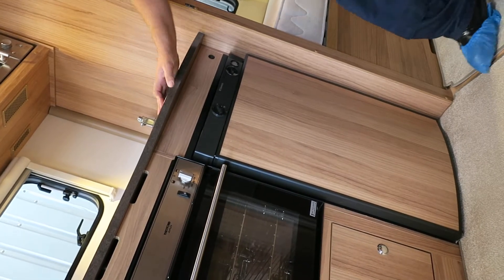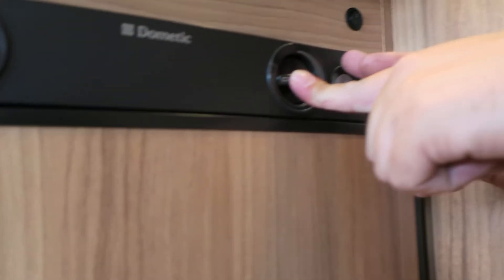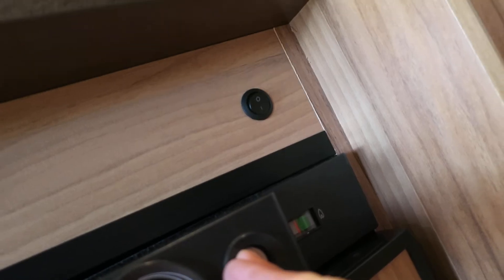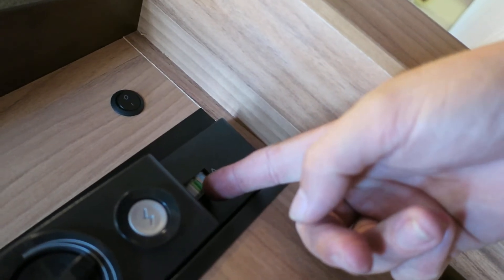For the gas on the fridge, don't be afraid - it's all sealed. Turn the dial down onto gas, hold in the temperature dial and hold down the grey ignition button. You can see the little bar at the end - when you hold both down, that's priming the gas and trying to ignite it. You'll see it shoots up into the green. When you let your fingers off, if that orange line stays in the green, the fridge is lit and operating on gas.